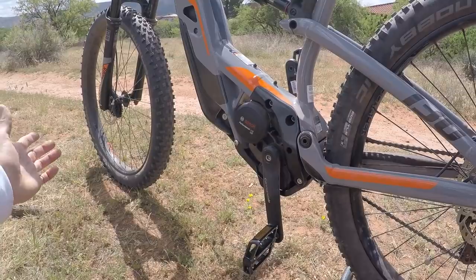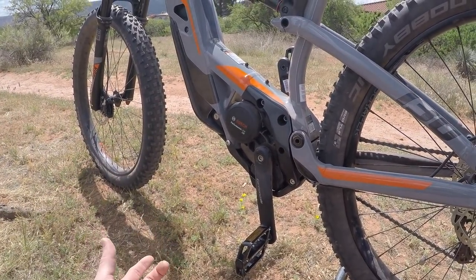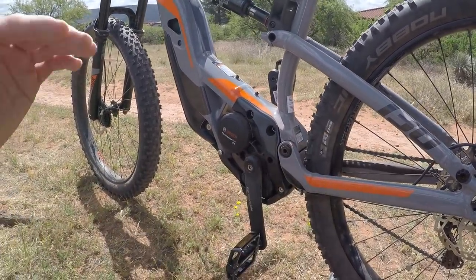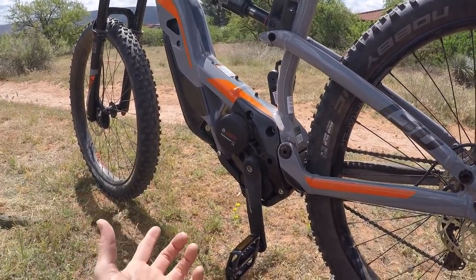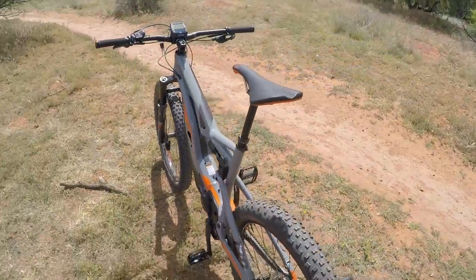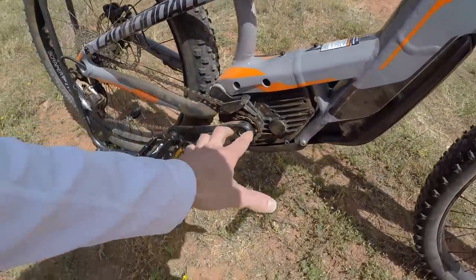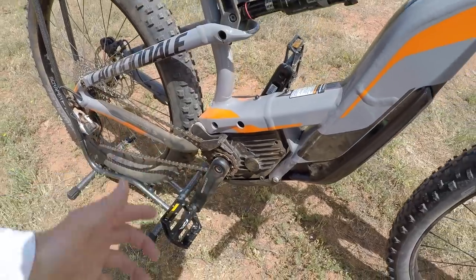And they've just released an update. So whether you had this bike from before or you're getting a new one, there's the eMTB mode, which is, in my experience, more of a torque sensing versus levels of output. The motor's rated at 250 watts nominal, but it peaks at like 600 watts. So it's very capable. And with that smaller chain ring we were talking about, 14 teeth, that spins at about 2.5 revolutions for every crank arm revolution. So it's spinning faster than you're pedaling.